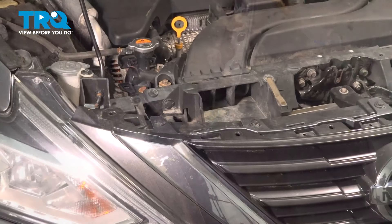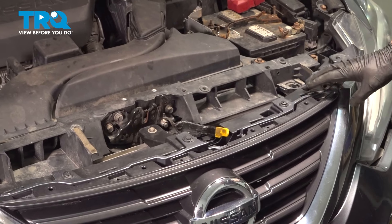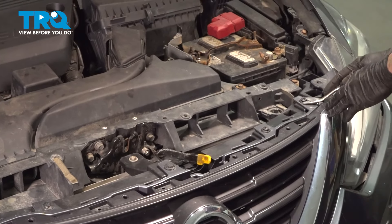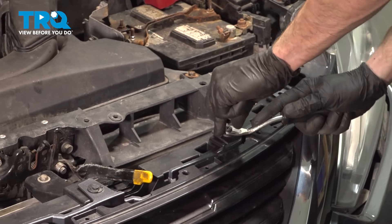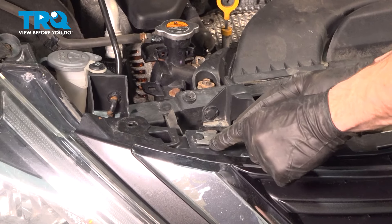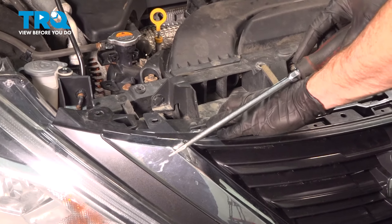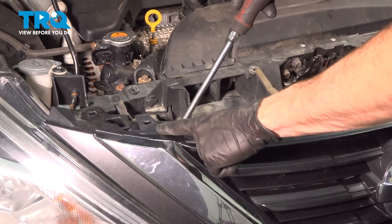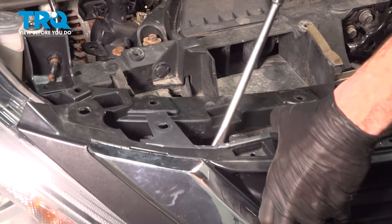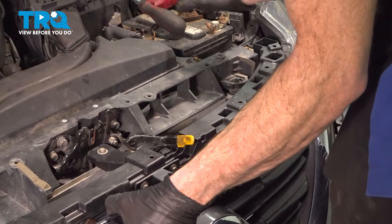Once we've done that, we'll meet in the engine compartment. Back up in the engine compartment, we'll be removing these five push clips that make their way all the way across. Remove the center, then remove the outer portion. Once you have these out of place, we'll carefully start prying the bumper cover straight out and away. Hold that bumper cover in place with your knee. With all the push clips out of the way, we'll be continuing on with a flat blade screwdriver. Carefully make your way inside this area right along this notch. We want to pry up against the bumper cover and gently separate it. You would just come right along this side here and remove the bumper cover.